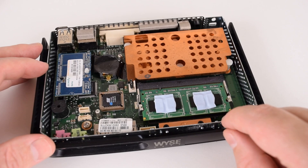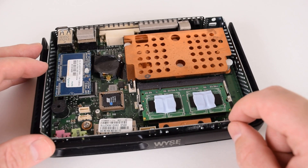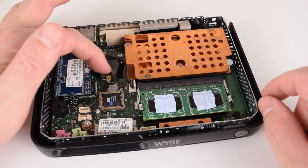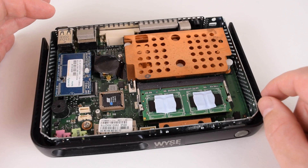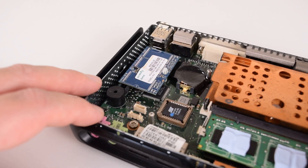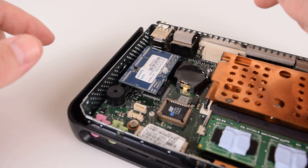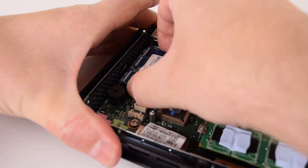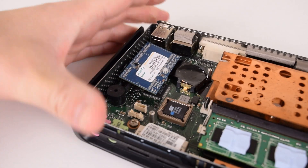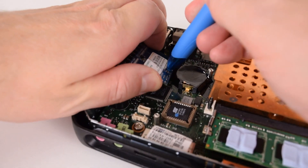Here we are inside the machine with nice copper cooling. There's a 512MB DDR2 RAM module with thermal pads on both sides making contact with the cooling, and it's upgradable to 2GB. The BIOS chip is removable which is nice. Here's the coin battery — you might have to replace it on your machine. And here we have the 128MB flash module. 128MB of storage is really small; even for DOS that's not a lot of games. So the first thing we've got to do is remove the flash module by wiggling it around a little bit to disconnect it from the IDE connector, then push it down to get it loose.